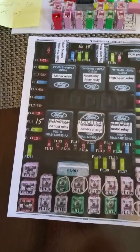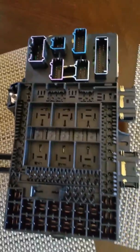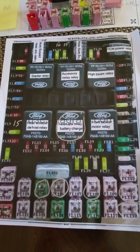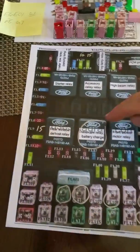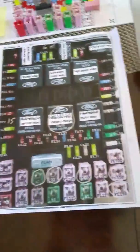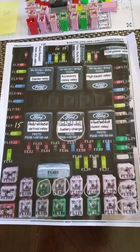There's a bunch of connectors on it. Here it is right here. One bolt, and take your power feed off, and remove all the parts, remove all the fuses and other relays that are not soldered in, and split this thing open. You can replace this unit right here, right in the middle, for $9.00. Ford wants $500.00 plus for the unit, and that's the only fix they have.